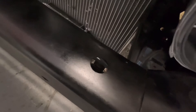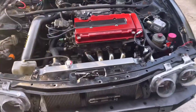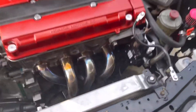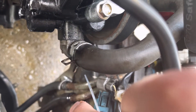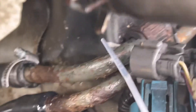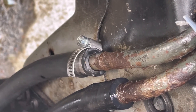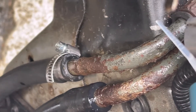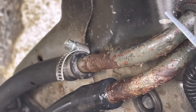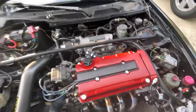Okay, turn it off. We got some bad news about the Integra. That rust right there behind the line — that's where it's leaking from. It's not actually leaking from the hose at all. So either we're going to have to replace this line, or put some JB Weld around it just for now until after wintertime.